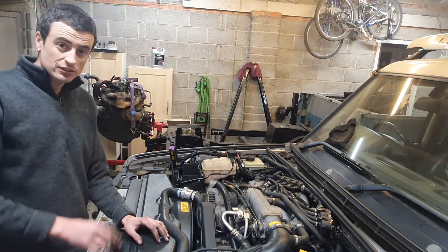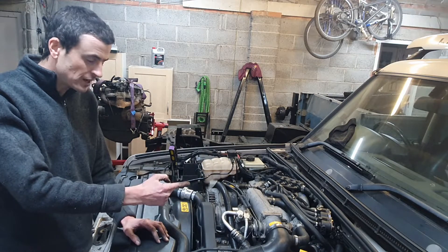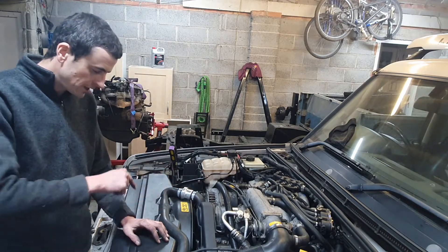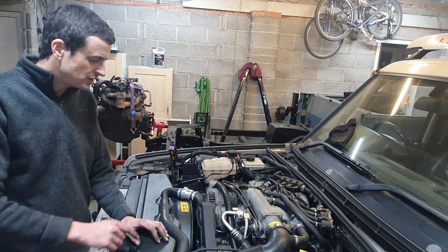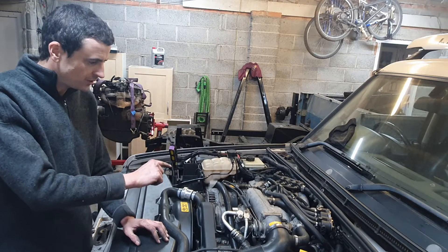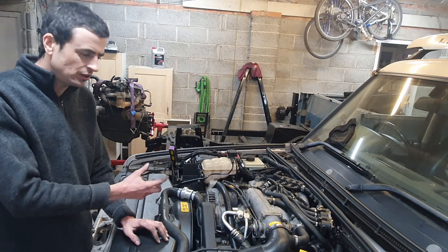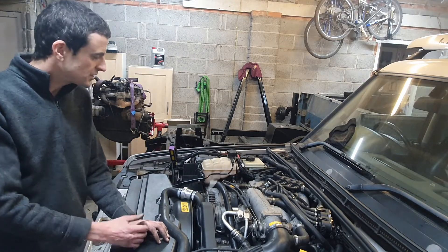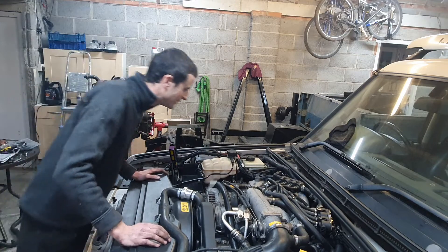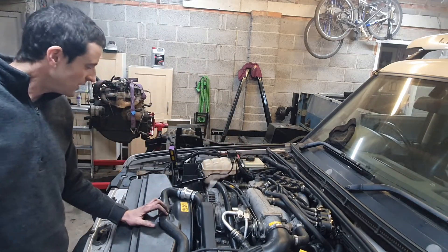The audio went wrong in this clip I'm afraid, so spinning the engine over went well. It took a long time — maybe 30 to 40 seconds or something — to get the oil pressure through, but eventually got there. I got a whiff of burning wires because I missed the large earth connection off the engine, so it all went through a tiny earth connection, but it survived, so that's good. And the next thing is I'm going to fill up the coolant.